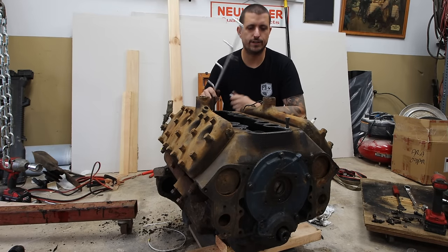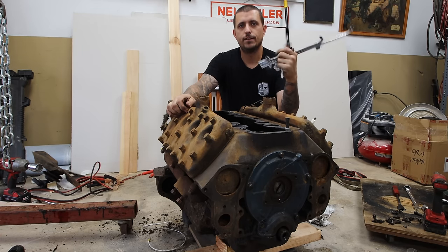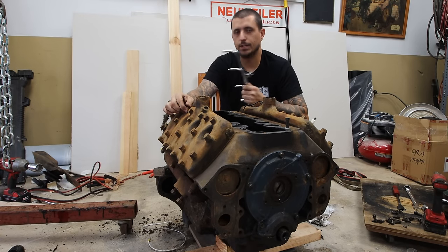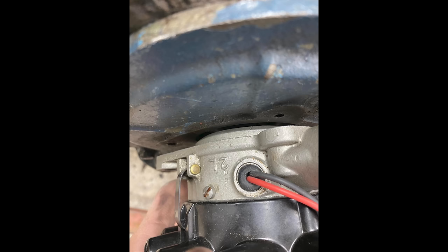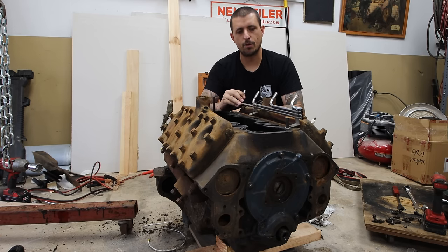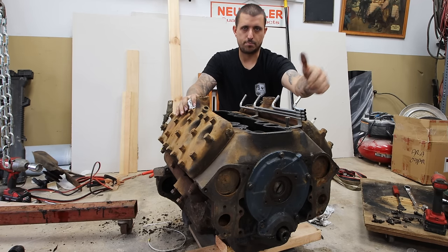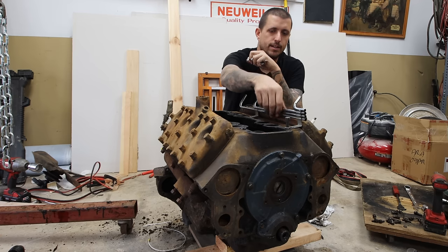Not all videos end victoriously. Some things I learned: this has a long snout cam. The two-bolt timing cover fits, but the two-bolt distributor does not. So I either need to find a spacer for the two-bolt — which Dick Spadaro used to sell — or I think someone makes a three-bolt to two-bolt timing adapter. Because the snout of the distributor is actually longer and it doesn't fit. The other thing I learned is I picked up these wire organizers for a flathead, and when bolted on they work great, but because I'm running an aftermarket intake and mounting the distributor off to the side, it puts the distributor right here on a 21-stud — same idea as with the later engines, off the generator mount. This plug wire basically runs right into the distributor, so I have to find straight wire organizers without this bend.